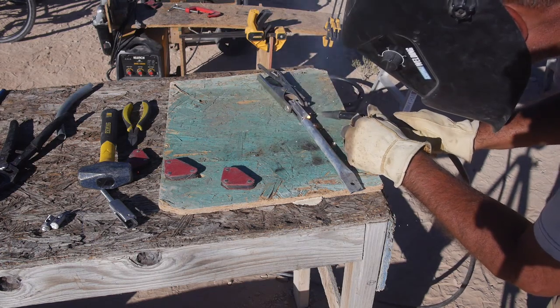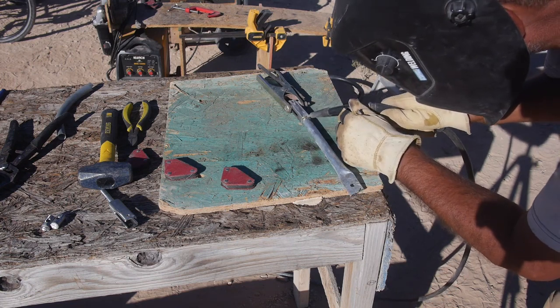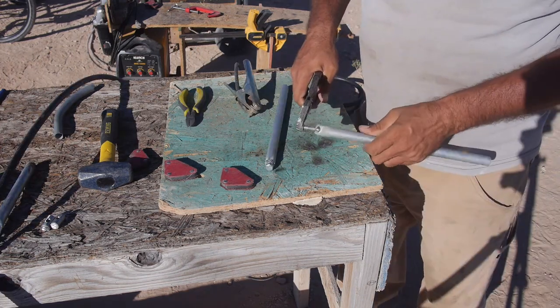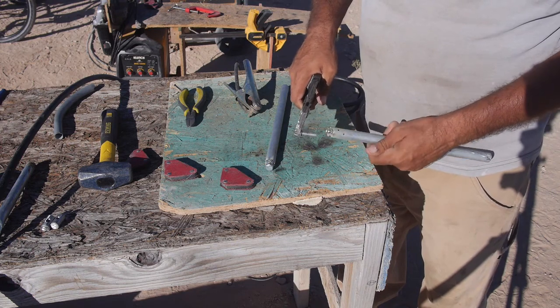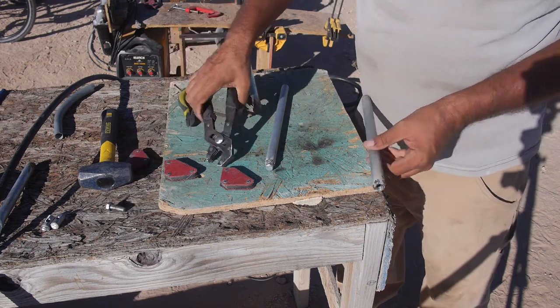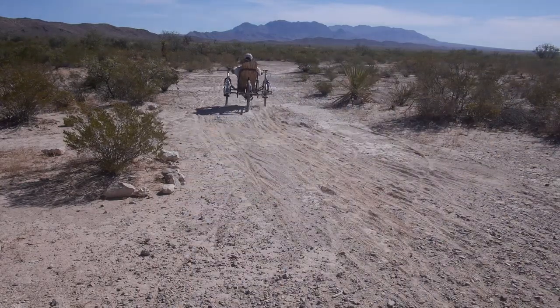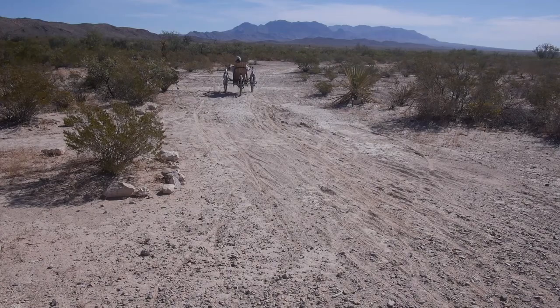Once I had Turtle to where it could turn, I also now have it so it will go straight — wow, does that make a difference. I can ride one-handed and it doesn't tip over. And it can coast now. Before it was snow-plowing; some days toe-in, some days toe-out, and if I stopped pedaling it stopped rolling all on its own. Now that it will coast, I have to work on the brakes. The next video I'll be hooking up all the electrics and probably the first solar panel tests.